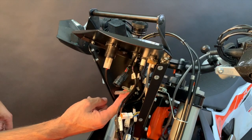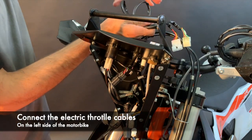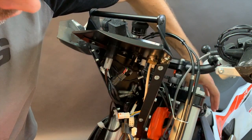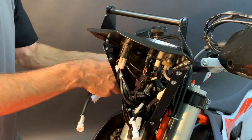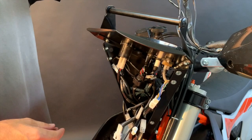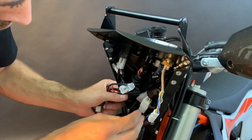Now we suggest starting with the speedometer sensor — keep it from the bottom. Take the connectors from the electric wire from the right handlebar and go around the neck to connect from the left side of the motorbike. Connect the speedo, the ABS sensor, and put inside the cables from the right handlebar — you can immediately connect this two-pin. Take all the cables from the left handlebar, put them inside, connect the six-pin, connect the three-pin, and put them inside the tower when done.